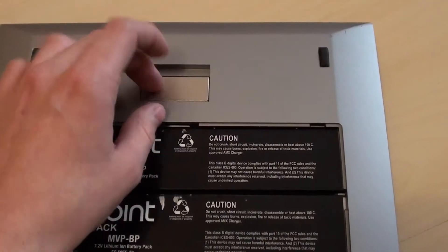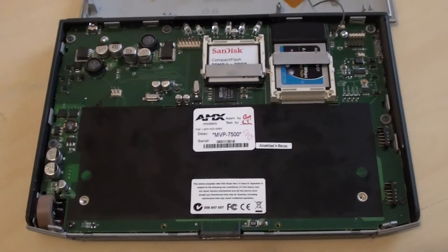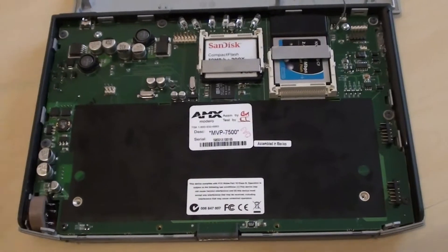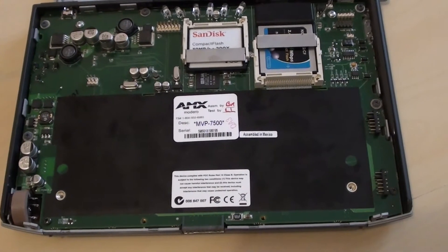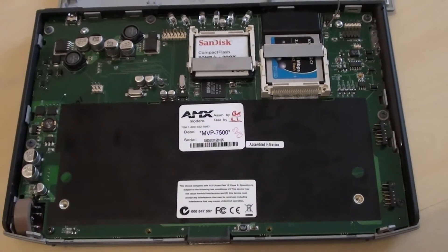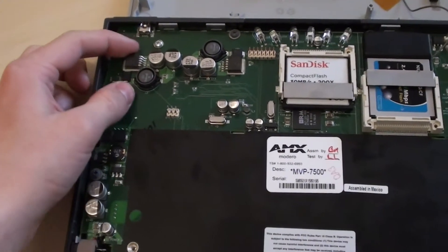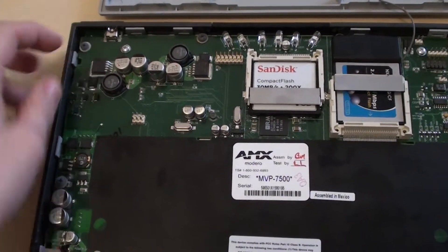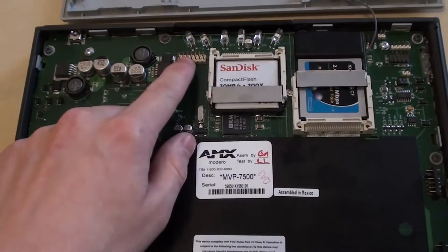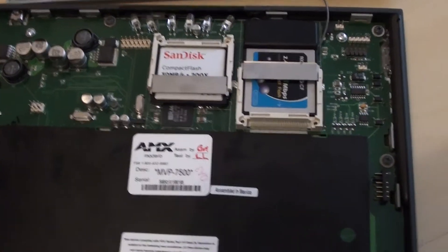You'll notice this is made of aluminium rather than plastic, so it's incredibly durable. Now with the back cover off you can see how sparsely populated the main PCB is. Compare this to a modern tablet like an iPad, where the main PCB is very densely populated and takes up maybe only 10% of the internal space. Here you've got a lot of surface-mount components that wouldn't look out of place in a desktop PC — lots of voltage regulators, capacitors, and even some pin headers for testing and configuration.